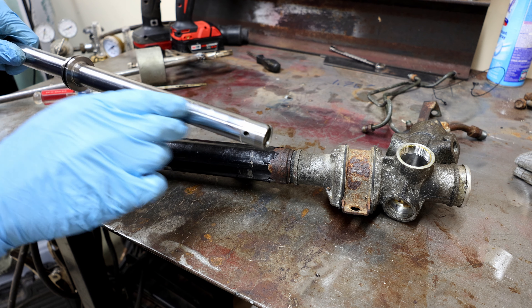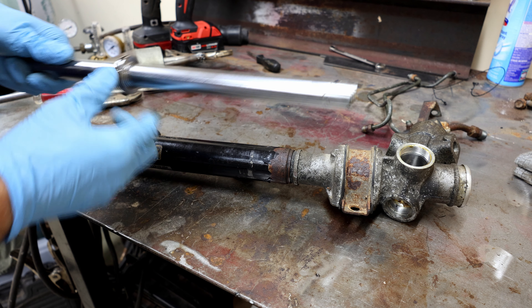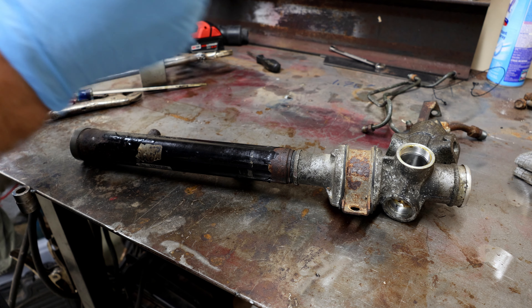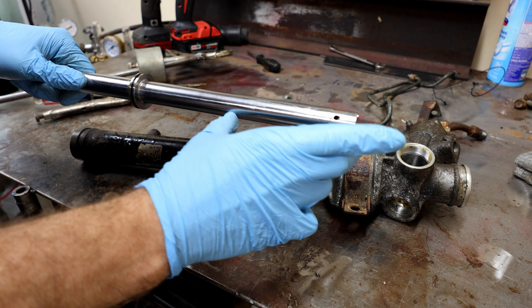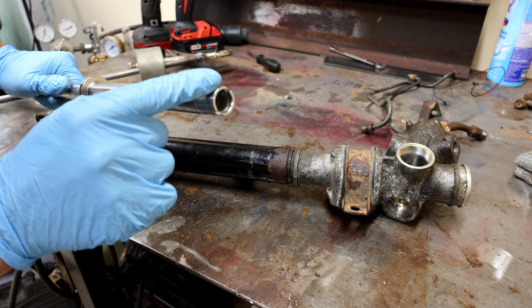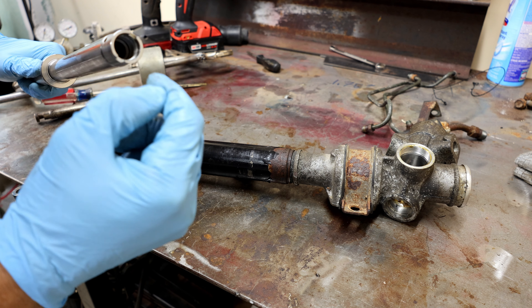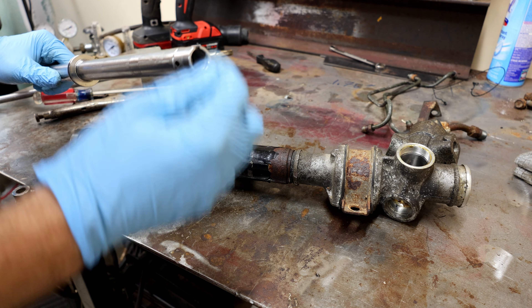This chrome rod is hard on the outside. I haven't really gotten into how hard it is on the inside, because basically I have to cut this section five inches off the end and then remanufacture this end. I've got to skim the OD, potentially skim the ID, cut the metric thread, and then cut this slot.